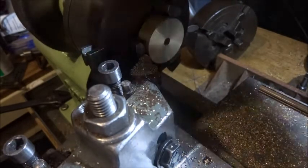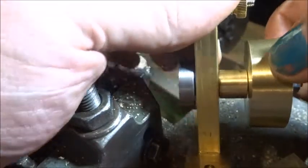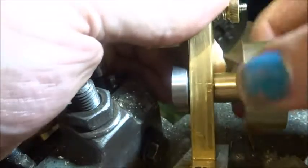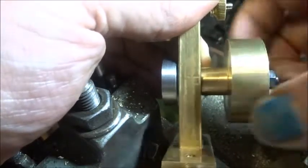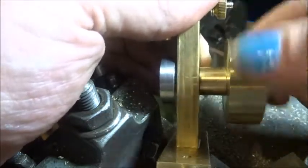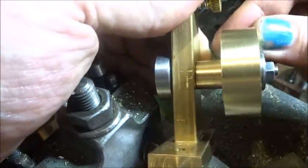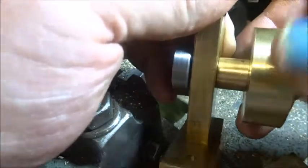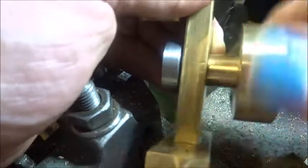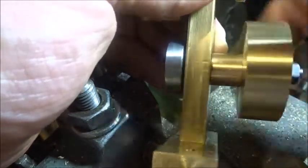If you've got a bit of blue tack or something to clean that out, it's probably as good as anything. Flat battery again, but I've just taken my time and got this pretty sweet really. I've given that a clean up — it's still not quite running true. There's the tiniest bit of wobble in that. To be honest, I'm probably not going to worry about it. The ideal thing would be to set it up between centres and machine the outside to get it running true again — that's probably worth doing. But if it's got five thou run-out, I'd be surprised. So I'm going to leave it at that. That's the flywheel finished.